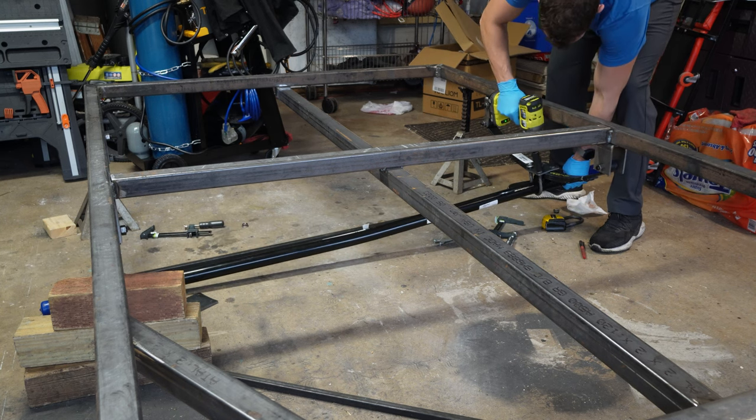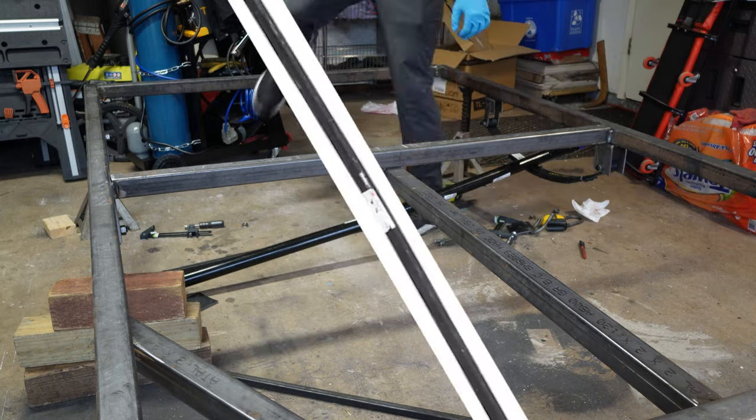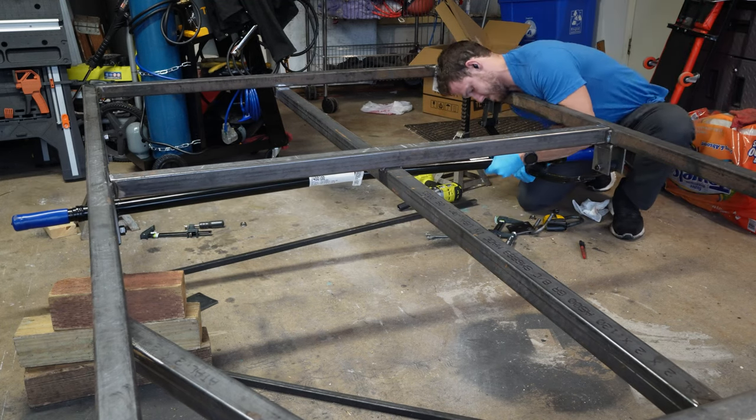This is where Past Hobby made the mistake of mounting the axle upside down. With the bend of the axle — it was a smiley face — you want it to be a frowny face, because when weight is applied to the top it flattens out your tires. So make sure you have a frowny face axle instead of a smiley face axle.